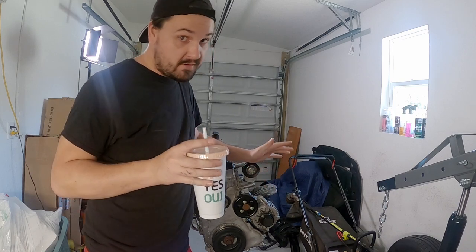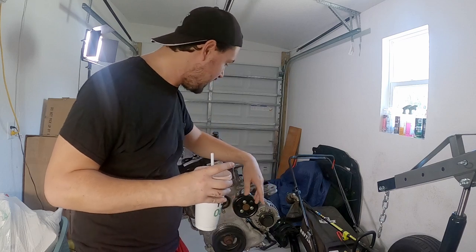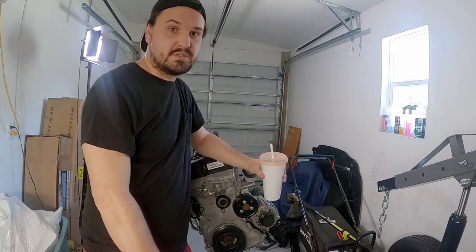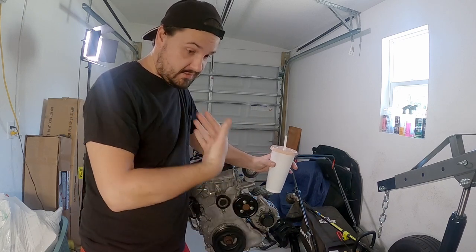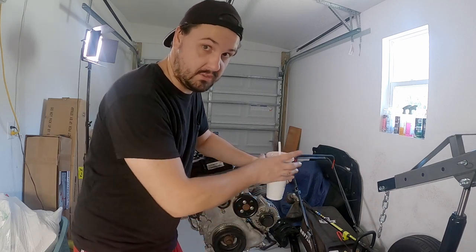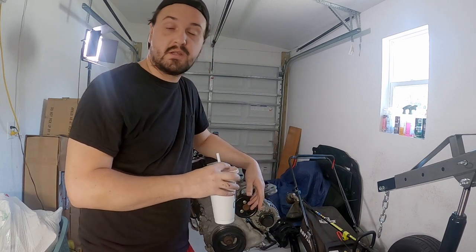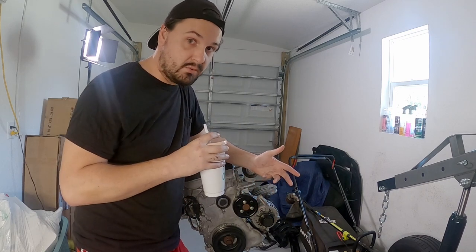So far I haven't seen anything crazy. Thankfully, from what I have seen, there's no holes inside of the block, so that's nice. All the damage is contained to the cylinder. It's bad enough damage to prevent the engine from running, but it wasn't as bad as it can get with these things, thankfully. As long as the cylinder walls are not completely scored up to death, it looks like the block will be savable.